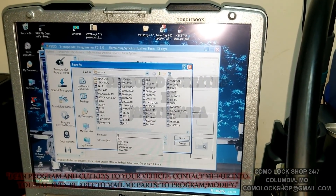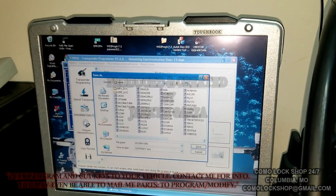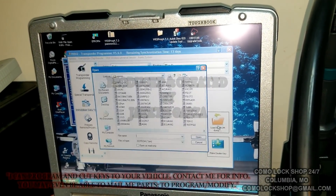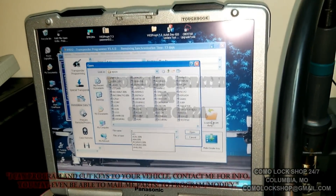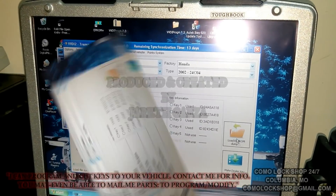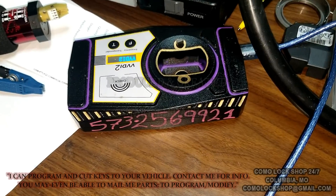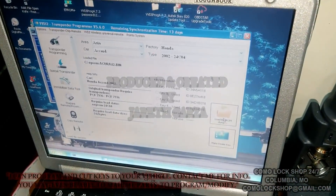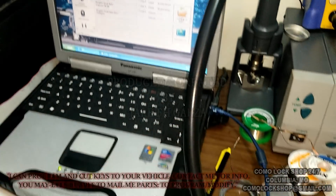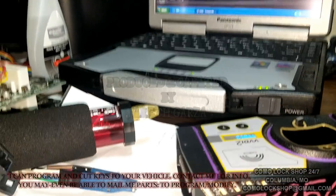Hit OK. I'm gonna get Acura again, but I'm gonna back it out to V2 and save. Now let's load it up and look at it. Go to V2 — and now it shows four keys in use, and we could now write a fifth key if we wanted to, or we could overwrite keys one through three, and all the keys out in the world would no longer work into the car.